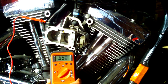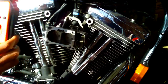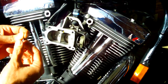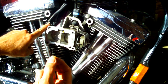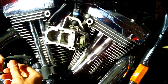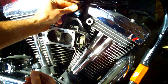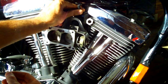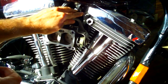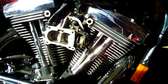We're done adjusting electronically. Time to disconnect our tester and remove it from the bike. Also remove the pin that we used to get voltage from that right-hand side violet gray stripe throttle position sensor wire — taking the pin out. We're also going to reconnect the cold idle motor, but first we'll power down the bike. Drop it back into the socket and seat it firmly — there it goes, it clicked, it's in there all the way. It's also got a good dose of dielectric grease on it to keep water and moisture out.